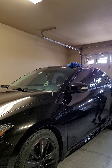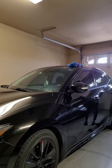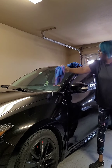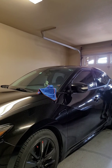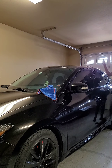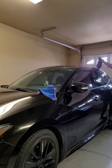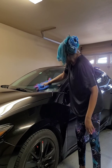Over time your car will have that mirror shine. I wasn't going to do this today but we're in monsoon season so I've started driving my car more and I don't want the water to leave water spots — and that's what this product is really good for. The window needs another circle, the back needs a side-to-side. Remember to shake the bottle every time you spray. Side-to-side here, then we can circle the windshield.